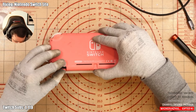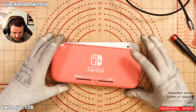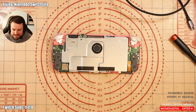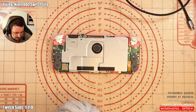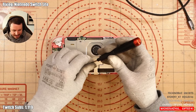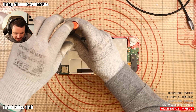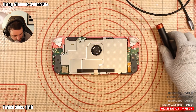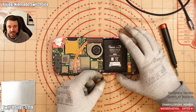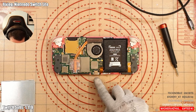Take out the SD card — oh, did he include the SD card? Yeah, he did. We've got two gigs on here. So all we've got to do now is just hopefully take the case off. He has done a better job at reassembling this than 50% of the professional repair shops I've seen. At Rocket, we used to have a lot of people come in saying 'I took this somewhere and this is the state of it now' — screws missing, bits of metal housing destroyed. He's put this back together very well, again considering hobbyist. So that's come off, which is exactly why it's not working — this has just come out of the FPC connector. But again, the board is very clean. I'm looking at this port and it looks pretty good.